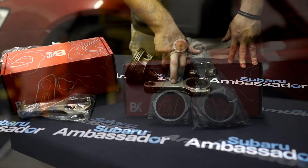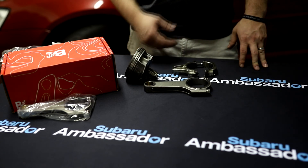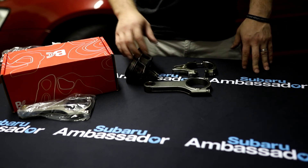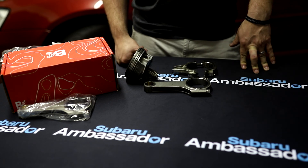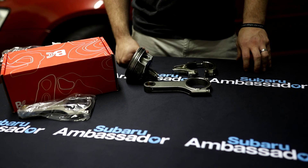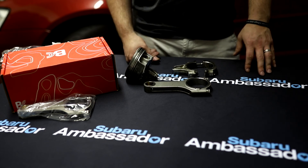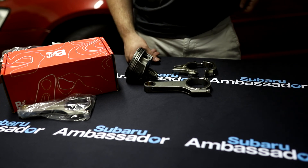Make sure you find a rod that fits what you're building. If you're wanting to build a really high horsepower car, an H-beam is probably not what you want — they're good for 700, 800, 900 horsepower, but beyond that you want an I-beam, which is very different in structure. They also make I-beams out of a different metal and vacuum out all the air from the steel while it's molten. Hope you all learned something about rod construction and what's important.